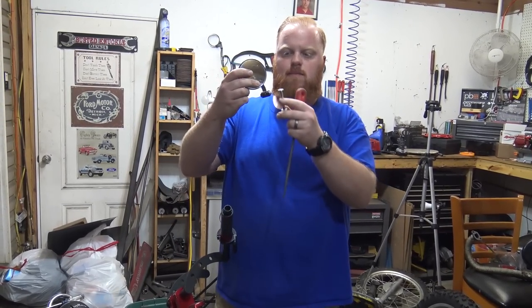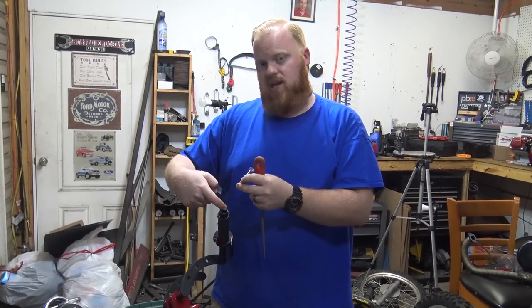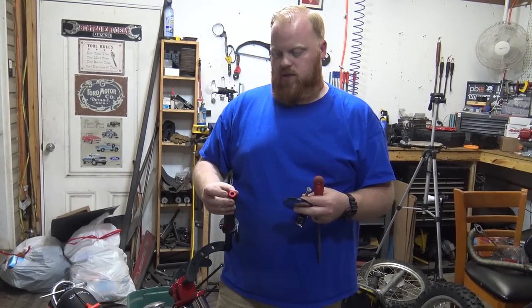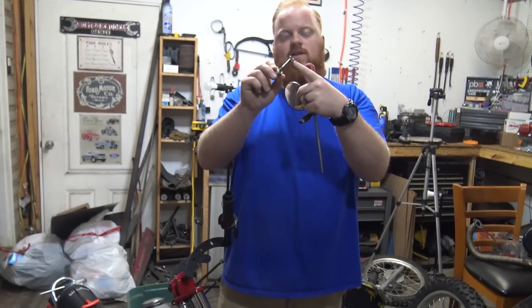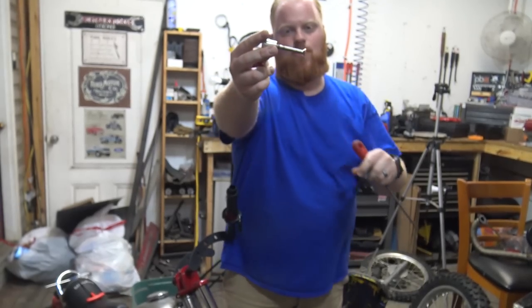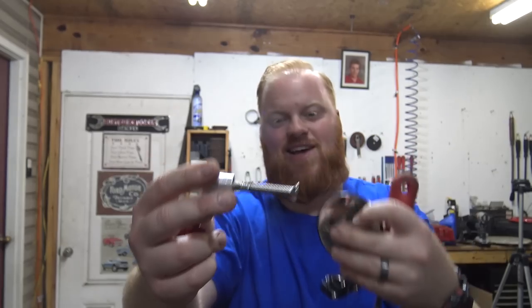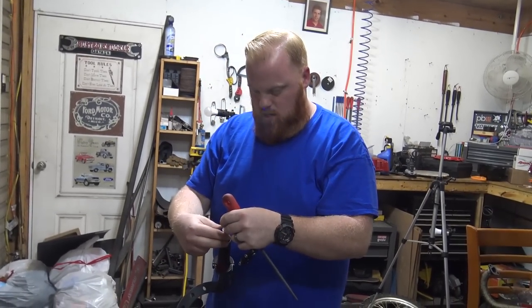Basically, these mirrors had a bolt that went through them and separates these pieces of aluminum inside the handlebars. Well, I wanted these handle grips with this billet end on the end of them, and I could not find a flush mount Allen head long enough, so I had to weld two together. Can they see it? Oh yeah. And it worked great though. That goes to show you, you can do it, you know.